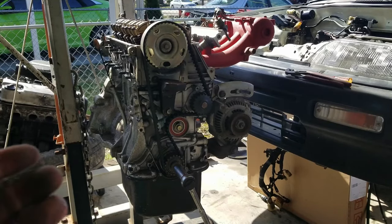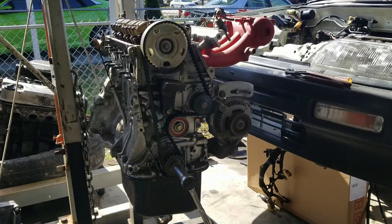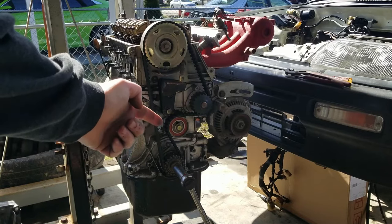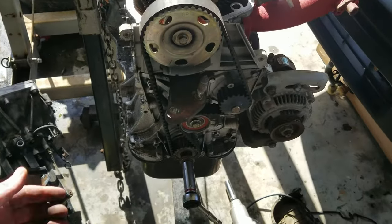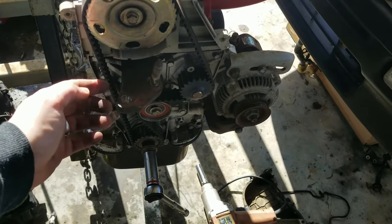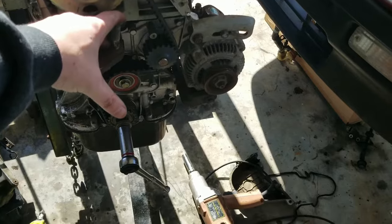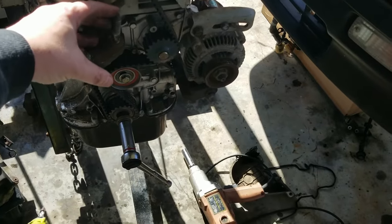It's pretty simple and hard to mess up. Now you have to get everything back together. I'd always recommend putting the timing cover back on because a rock could fling up, get stuck between the gear and belt, and cause all kinds of problems. With the engine out of the car that's not a concern, but when the engine is in the car you'll have to remove the engine mount to get the timing belt over it — otherwise you'd never get the belt on.